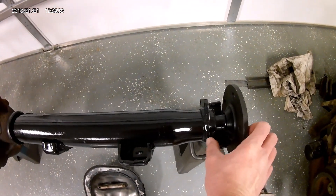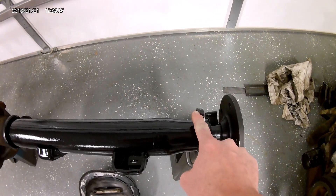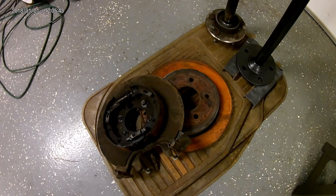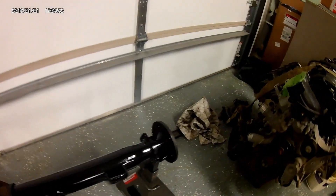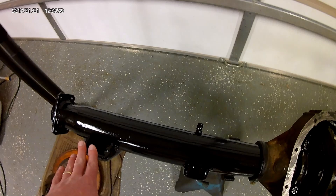It did involve taking some measurements, one of which I'll show you in my chart in a second — the distance from the inside of this flange to this flange. I plan on reusing the stock brakes; I'll clean them up but they'll bolt back on. My distance here was kept exactly the same since I reverse-engineered this, and it's the same on both sides. After cutting everything down, I think this side ended up being 30 thousandths off, and this one was maybe 60 — super super close.